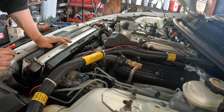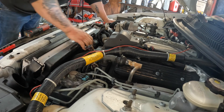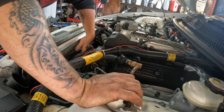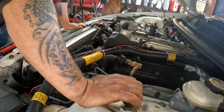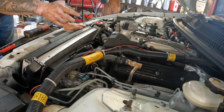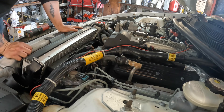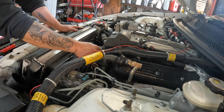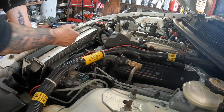Now that that is out of the way, you should just pull up on the fan and it should come out. Let me go ahead and get these hoses off. The hoses are going to have just these little squeeze clamps - that should be three of them: one on the thermostat, one on the upper portion of the water pump, and one that goes into the throttle body. Let me pull all these hoses off so we can get them out of the way, then pull the fan out and I'll show you where all the connectors are.